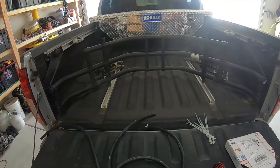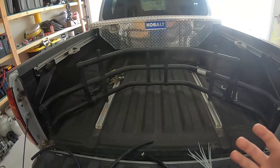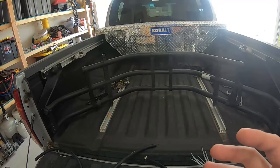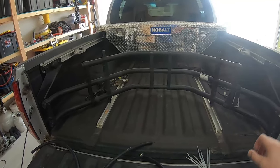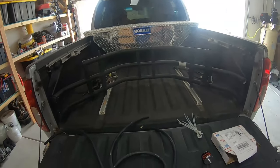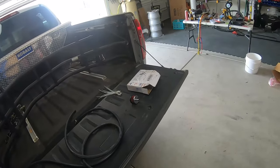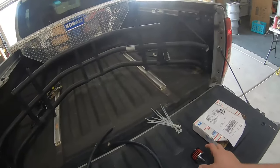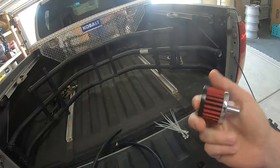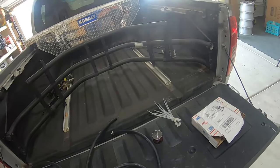When you cross into some water you don't drown it and suck water into your differential. It also helps keep your stock filter — which is a pretty crappy design — from getting clogged. Once it becomes clogged you end up building pressure in the axles and you blow out your seals. This truck has 227,000 miles on it right now. Even a two-wheel drive truck, people still have problems with axle seals getting blown.